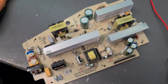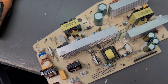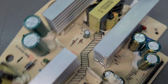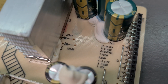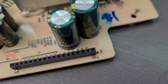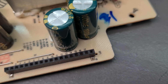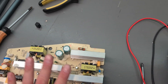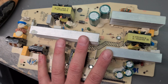Because I thought it's something on the mainboard, I checked the voltage from the power source. On port 14 to 18 you need to have 50 volts for sound. If you don't have the 50 volts, your speakers will not work. I checked it and I only had 5 volts. So if you got 5 volts, you need to replace the mainboard or the power board, or you need to repair the power board.